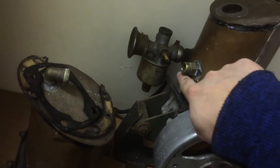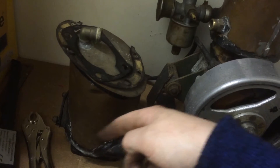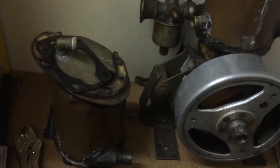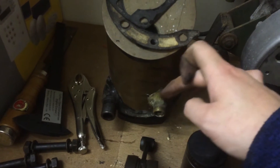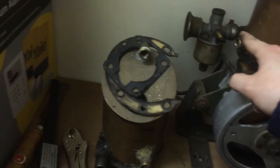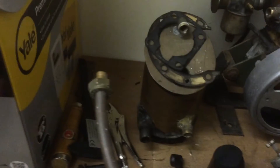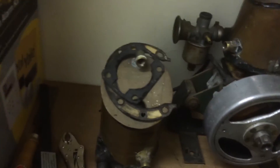This one we'll be a little bit more sceptical of - it's had the top pipework broken out and it's also had a lot of repair work down in the bottom corner from when it was originally done. It must have looked much the same as this one when it was done, but this one must have taken a little bit of a knock and been repaired. This one has also had some epoxy resin put around this pipework here. Usually both engines were pipeworked together - joined at the tops - which must have caused a lot of vibration, which is probably what broke that off in the end.